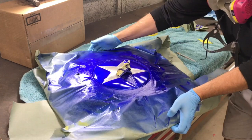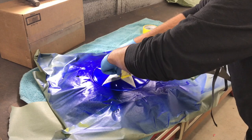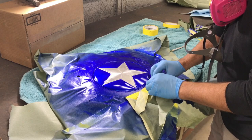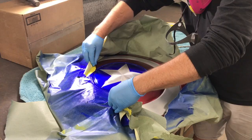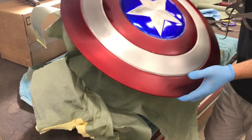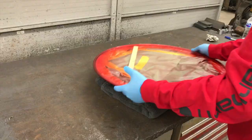I've had more painters take cars outside after they're done and say, what do I do? I didn't get enough paint on the rocker. Continue. Straight line. Invisible straight lines. Hit where we came down to that sail area and stop. Band. Important banding. Now we get up to the hood. We haven't done the sides yet. We're going to complete the rear. We're going to complete the hood. We're going to complete the front. And then we're going to walk the sides.